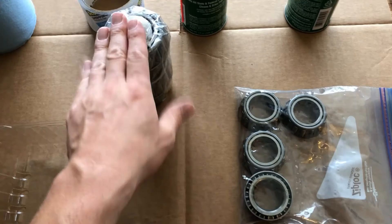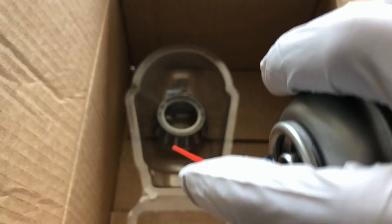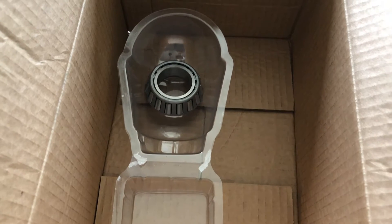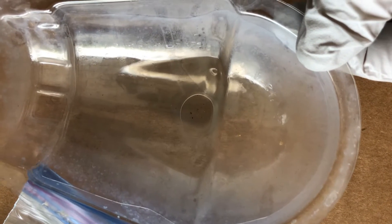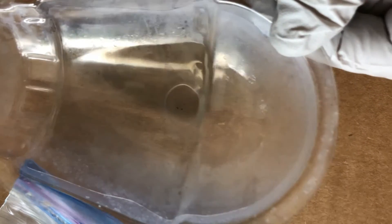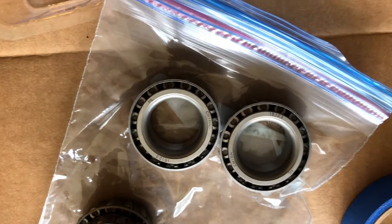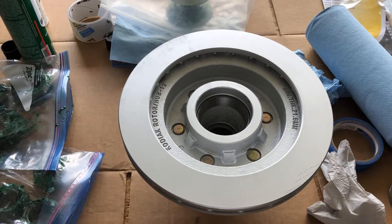The general sequence is: get things cleaned up, pack the bearings, then get out the rotors and take a look at them. My method is to use a bit of scrap plastic and flush out anything, removing residual oils from the manufacturing process to ensure good bonding with the grease. For those who think I might be overdoing it — you can actually see inside the bearing there's real gunk floating out, not just dots on cardboard. I'm glad I flushed that out.